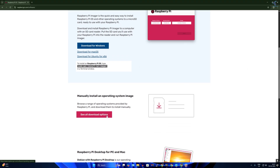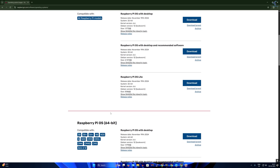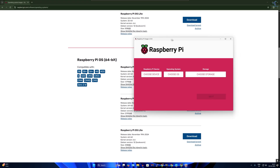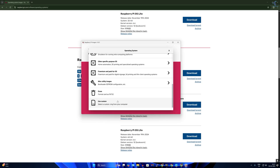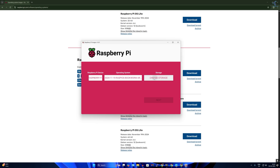Click on 'See all download options' and scroll down a bit. Here you will get a 32-bit operating system for Raspberry Pi, and here you will get 64-bit. In my case I am using the Raspberry Pi 64-bit Debian version 12 Bookworm. Open the Raspberry Pi Imager application, click on 'Choose Device', select your Raspberry Pi version (mine is 4), then click 'Choose OS', click 'Use Custom', and select your extracted Raspberry Pi .img file.